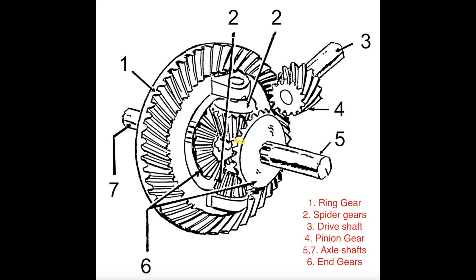Before we start, let's visualize what we're doing. Ring gear backlash evaluates how tightly the ring gear meets up with the pinion gear. Our backlash is too big, so we need to slide our ring gear assembly over to the right side so it mates against the pinion gear a little more tightly. Traditionally that was done with shims — you take a shim from the right side and move it over to the left. In this diff we've got threaded adjusters, but remember the principle is the same.